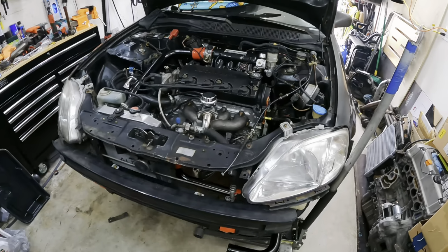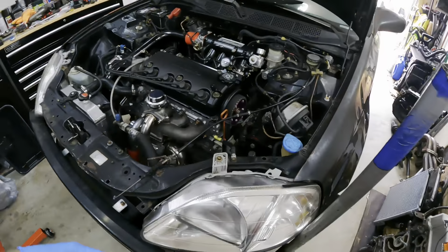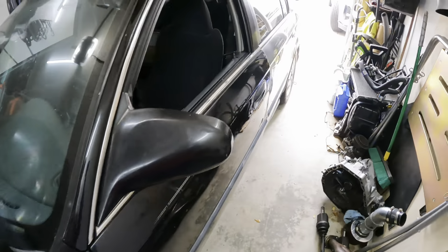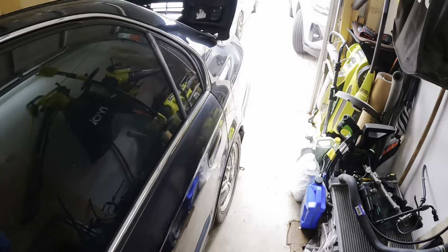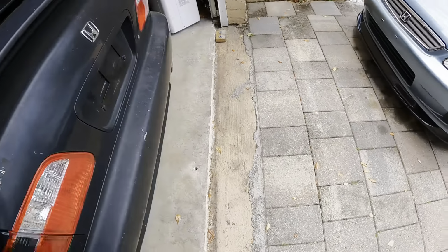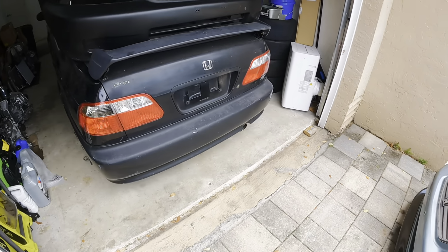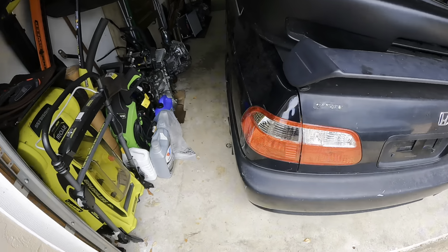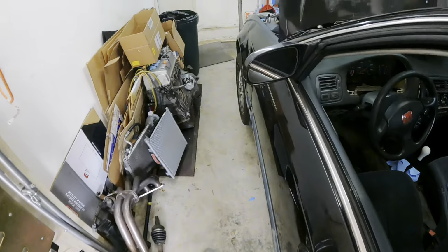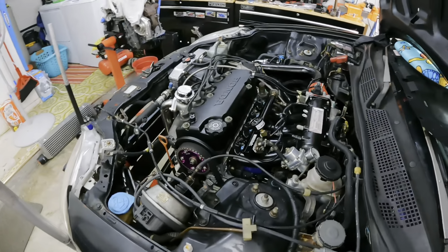Alright, well, as you saw, I got Chico's car up and started. We're having an issue. It's too much oil into the turbo, I believe. It blew out the seal on the exhaust, I think, because it smokes like a freight train. I'm still clearing the smoke out in the garage. We're going to have to address that. I'm going to have to take the downpipe down, just verify that that's what it is first, because I can't imagine it's the motor. It just sounds too healthy.